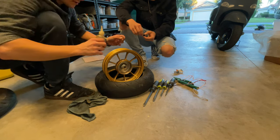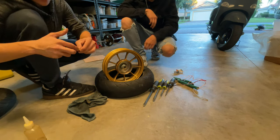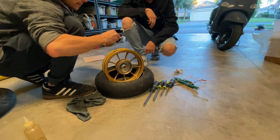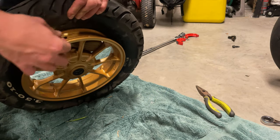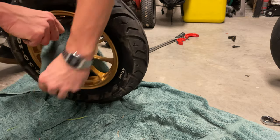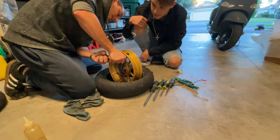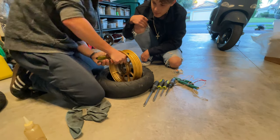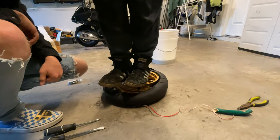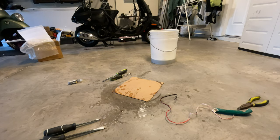You want to put a little bit of oil in the rubber part. Lay that valve in the hole, and then with the pliers, without scratching the rim, you want to grab the thing and push it with your fingers. Really. Right, and there it goes. If you do it in the grass. Yeah, let's do it in the grass. He's jumping on it.